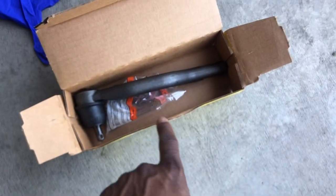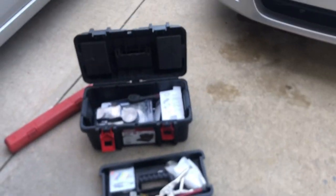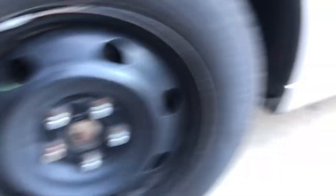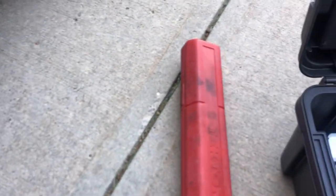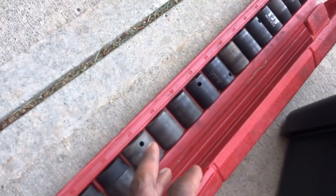So what do we need here? Of course, a new part — not new end links. We need gloves, cause somebody messed up my old ones. You need a jack to lift the car up, you need the car itself, and your tools. For the lug nuts, these are size 21, so you need your 21 socket — it'll be in this box somewhere — and a ratchet, but you also need a breaker bar to take the lug nuts off.